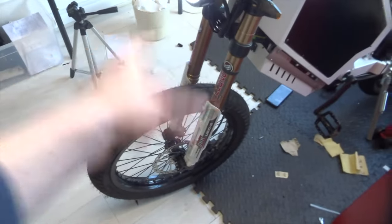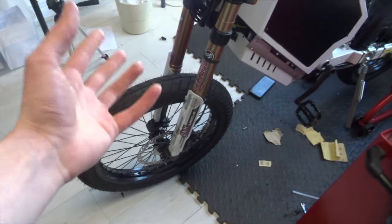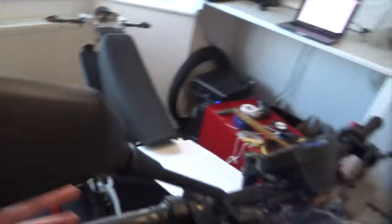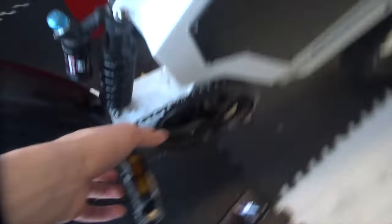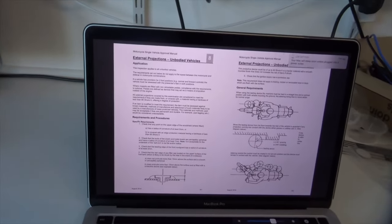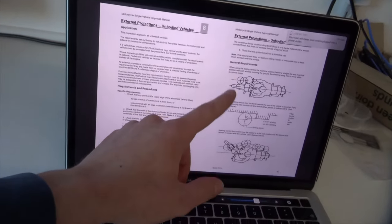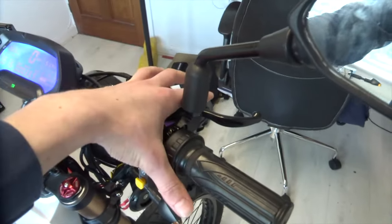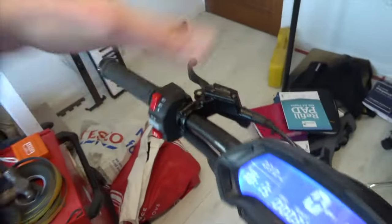They say that any part of the locking system can't act directly on the brake. Talking about brakes, one of the weird parts of the test concerns the brake levers — you can see mine have a little ball on the end. That comes under the external projection section, which covers stuff that sticks out on the bike like pedals and handlebars. However, if you have pedals fitted like I do, you can ignore all of that section apart from this one detail about the brakes. This does limit your brake choices, since only certain ones have this ball end — Tektro, the Sur-Rons I've got, and also the Magura MT5 brakes. Watch out for that.